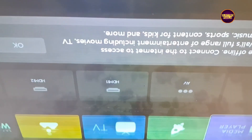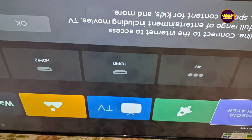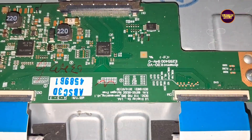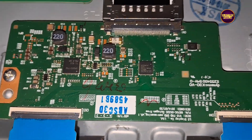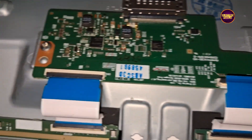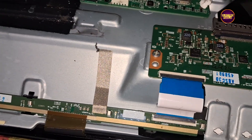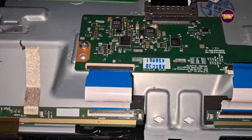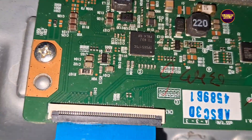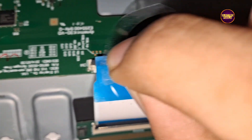However we can repair this panel using a temporary fixing method by blocking the gate signals from the shorted side. This TV comes with a 43-inch LG panel and an LG TCON board. So here it's better to use the taping method for blocking gate signals. The panel scalar board is connected with this TCON board through this FFC cable. So one by one we need to remove the FFC cable and block gate signals to that side using the taping method and check if the picture is okay or not.